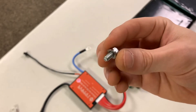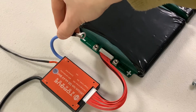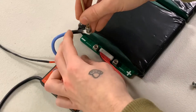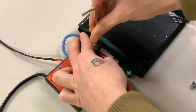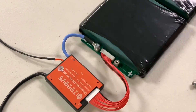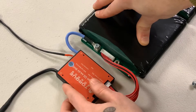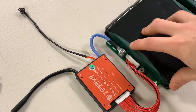To connect the ring terminal connectors to the battery terminals, we'll use two M5 by 10mm bolts with an M5 washer each. Start by connecting the battery negative wire to its terminal — place the socket cap bolt with washer over the ring terminal and carefully bolt it down. You want the wire laying in this position to allow the most room inside the board, so the BMS can push up as close against the battery as possible.